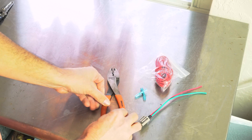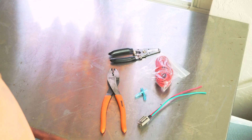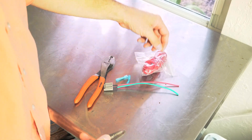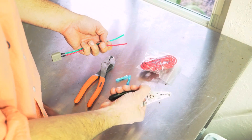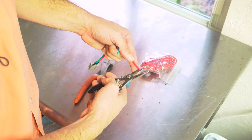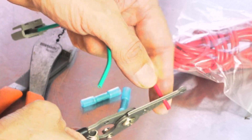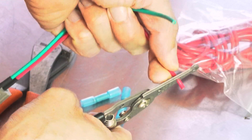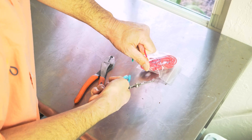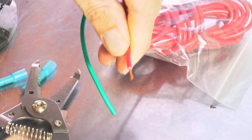Four o'clock chance of rain, so lighting in the garage went from pretty bad to impossible — we're going to do our work in the kitchen like a real man. If you found my channel through the car vids, check out my pizza vids too. You really don't need any crazy toolage for this, just splicing wires together. I like these simple clamp-style wire strippers — this is what real electricians use. You stick it into the right size and you just kind of nip it around, then pull back a little and let the stripper take the insulation off, so you end up with all your strands intact.